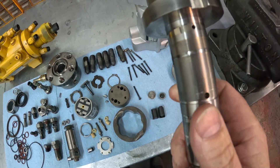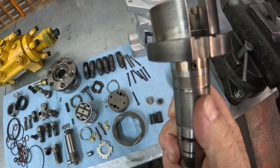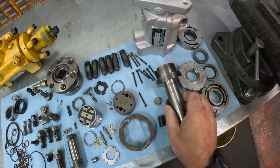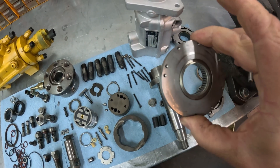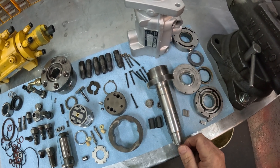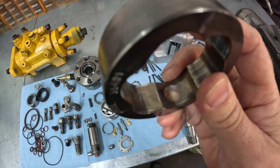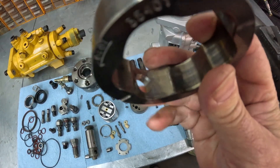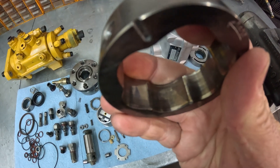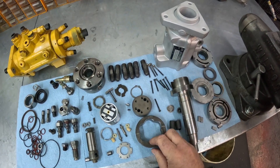The drive shafts can also get excessive seal groove wear and cause a crankcase dilution problem. Also, the shoulder that the needle bearing assembly rides on can go flat or start to flake and chunk out inside the injection pump. Sometimes these cam rings can also get flaking, eventually go flat, and can cause a misfire or a dead injection. It also causes metal to go through the injection pump.